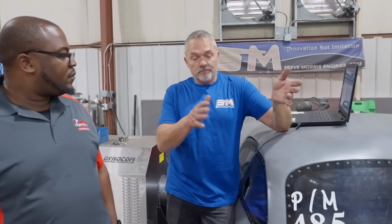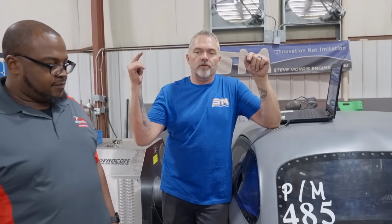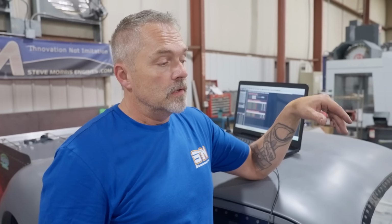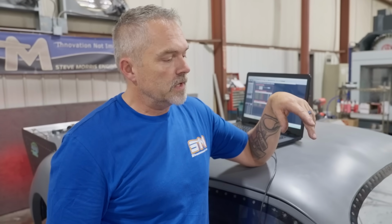This is one of the things that we're going to do. We'll run through and test all of these right now, the output. But as it's running, after we get this idling, the next thing I'm going to do is make it idle on one set of injectors and see if it drops a hole, which would mean a bad injector, and then flip it over and make it idle on the other set of injectors to make sure everything's working. Because if you run it down the track with one bad injector, it makes it into a freaking torch. And there'll be a half inch deep trough in your cylinder head and block. It probably won't make it to the 330 before it's burned up and gone. So we're going to test all the injectors before we go any farther, just to make sure there are no other bad ones, because Perry does have a set of smaller injectors that are perfectly fine to put in there. I'll just change the fueling strategy just a little bit and it's fine.